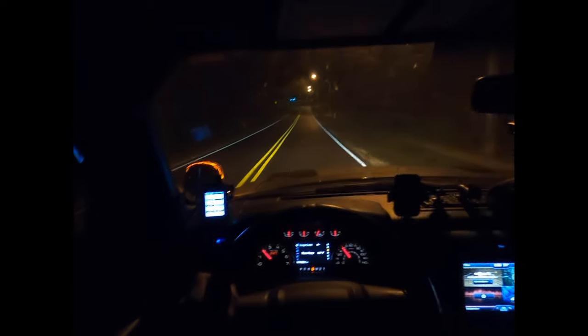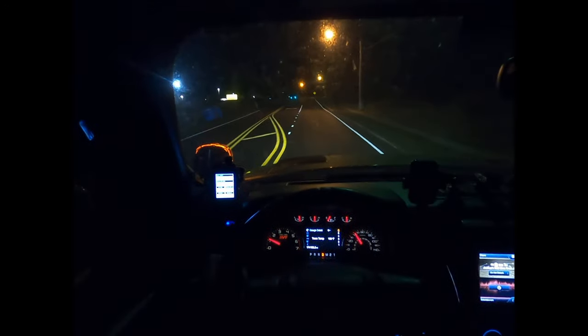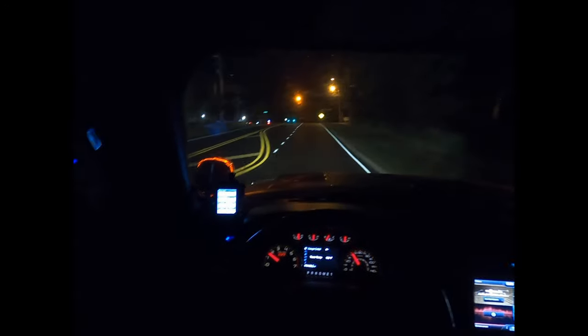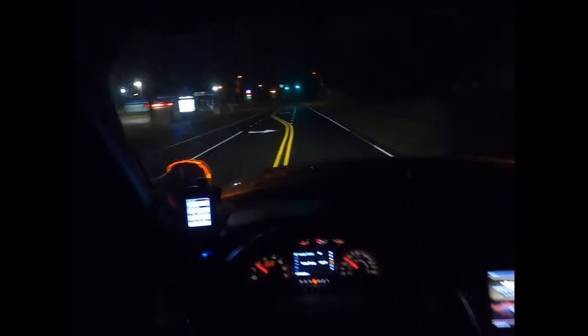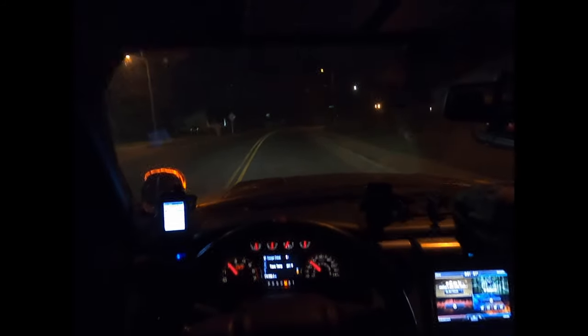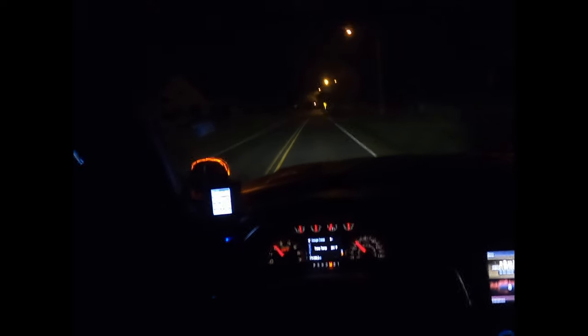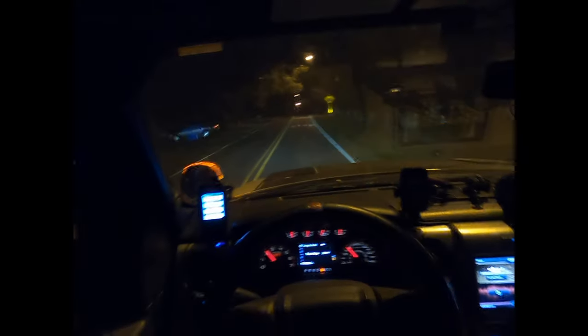It's already hunting at 40. Trans temp is 200. We're going back to manual mode — manual mode is disengaged, now it will. Taking it back down to a lower gear and it's warming up pretty quick, so we're going home right now. I'm going to check the fluid level and go ahead and top it off. I don't think that's going to fix it, but I'm going to top it off and try — might get lucky. I'll see y'all in a minute after I check the fluid level.